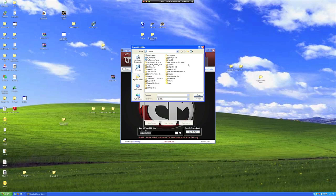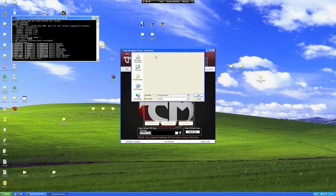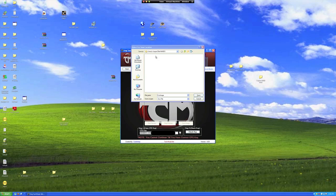You'll need to locate the file with your NAND dumps in it. Go ahead and choose one of the NAND dumps. A DOS program will open up instantly, creating your glitch file. This doesn't take very long. You now have a glitch file built to flash back to the Xbox's NAND. Hit any key to continue. You will be prompted to save your file. I like to save it in the same folder as I keep my NAND in.